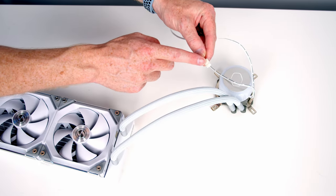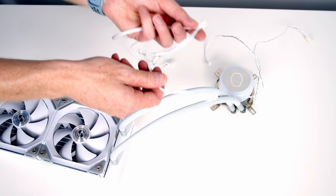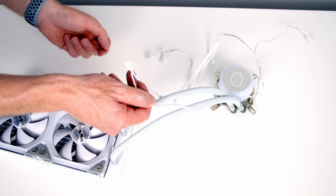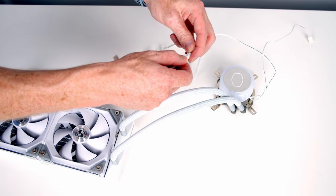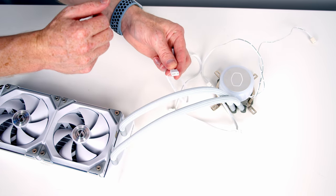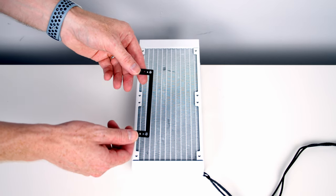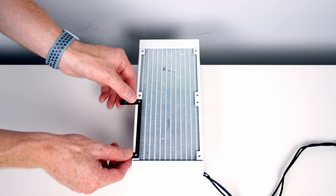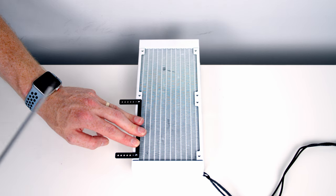As we're not using Cooler Master's fans we only plug one into the splitter cable. On the other end is a standard 3-pin 5V ARGB connector which goes into the ARGB header on our motherboard. Although I'm not installing my radiator at the top, I'll show you how the offset bracket works. Line the bracket up with the front and rear of the radiator. Lian Li include two different screws depending on your radiator's thread — I'm using the ones marked D. The kit also includes two additional brackets; if you were installing a 360mm radiator you'd extend over to the side, though a 360mm won't fit in this case.